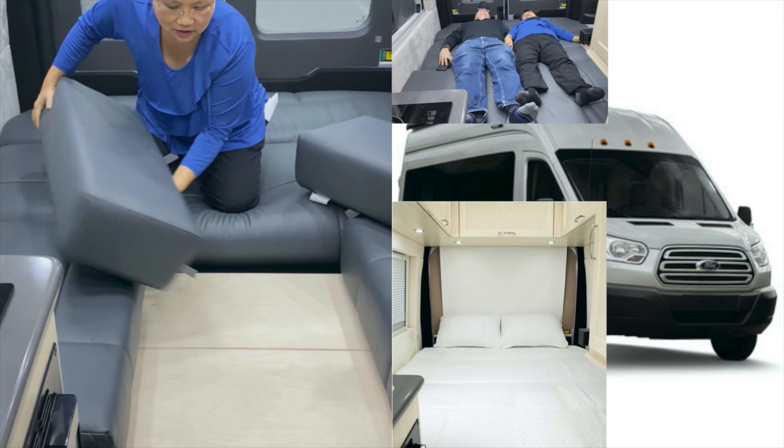Up here above the door is a 2000-watt inverter that uses your lithium batteries to create power — you can plug in appliances, run your TV, DVD player, all off your batteries without having to start the generator or plug in. This is the controller for the solar panels; there's not much for the user to interact with, but you can monitor what's going on. Right now it shows fully charged batteries at right about 14 volts.